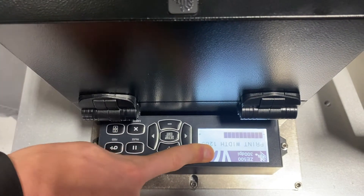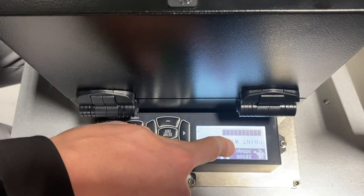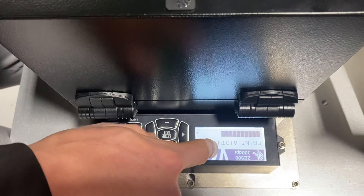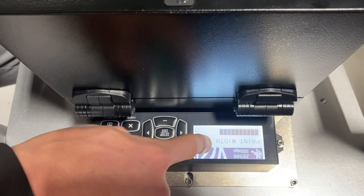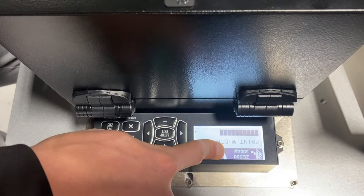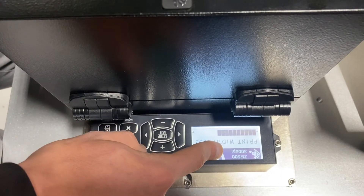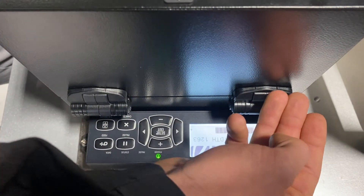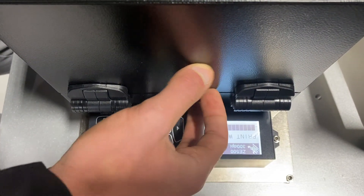Print width is pretty important. The Zebra measures in dots per inch. So for example, this Zebra printer is a 300 DPI — 300 dots per inch. Let's say I have a label that's three inches wide; my print width should be at least 900, which is 300 times three. If I'm trying to print on a three inch wide label and I have this set at 450, only half of my message is going to print on the label width-wise. So if you notice we're getting a perfect clean cut anywhere width-wise of the label, then we need to make sure that our print width matches the actual width of our label.